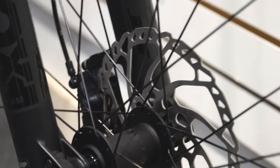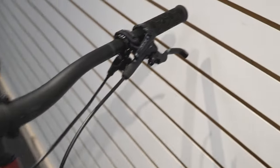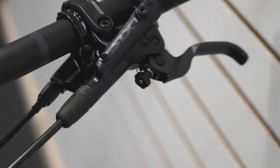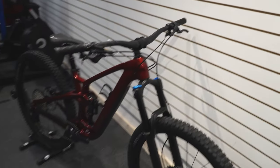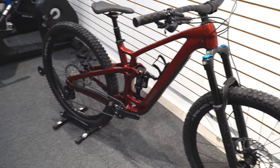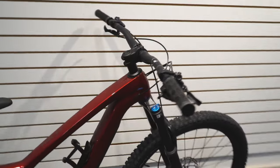Brake-wise it's a solid setup. You've got the SLX four-piston brakes, so it's going to stop really well. Good amount of control and modulation — as with Shimano it's responsive and touchy — and you have a quick-adjust dial for tool-less reach adjustment, which works really well for anyone looking for a customized feel from the brakes. The SLX stuff honestly performs pretty close to the XT stuff; it's just a little more affordable and technically weighs a little more. The rear brake is the same four-piston setup.